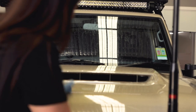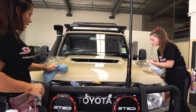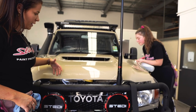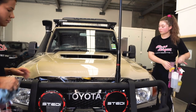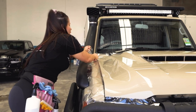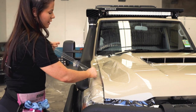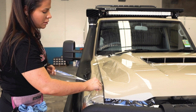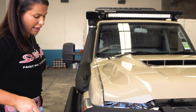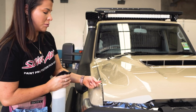It's very important that you check for any debris as you go. Now that this area is sealed I'm not worried about debris or water flowing and opening this back up, so I'm going to work back to the sides. For the dimensions on a 79 bonnet, we use 1.7 meters. You can measure a bit more, but you don't want too much excess on these bonnets — otherwise the film gets bunched and it changes the angle of the material when there are too many bunched fingers. So just be cautious you don't have too much material.